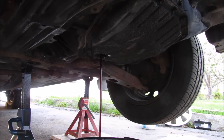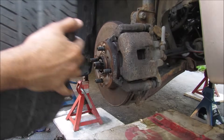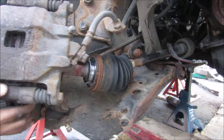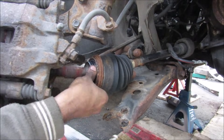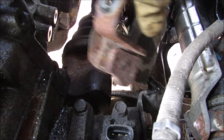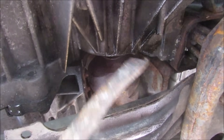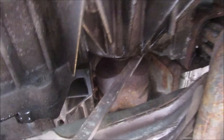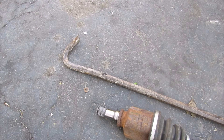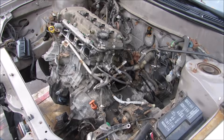Drain the engine oil, drain the transmission, and remove the wheel. Now I'm going to remove the 30mm axle nut, push the axle through and then remove it from the spindle. Over here at the back of the engine I'm going to remove this heat shield that goes over the CV shaft. Underneath the transmission this is where the axle connects to the transmission. I'm going to use a big pry bar here and pry out the axle. I was able to get out both axles using this big long pry bar — for the passenger side I got it from the top and for the driver side I got it from the driver side wheel well.